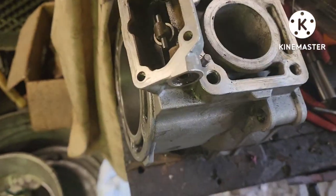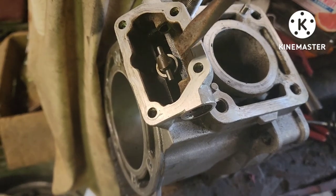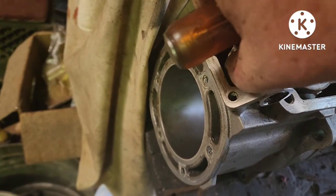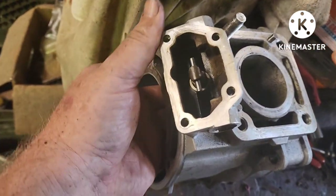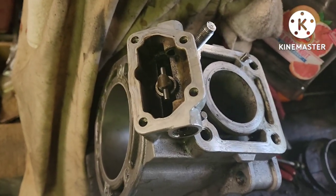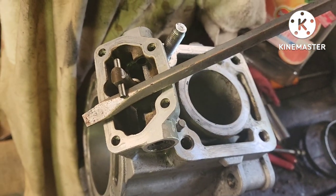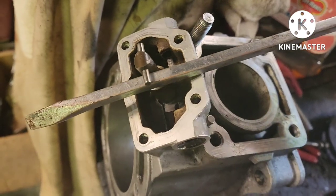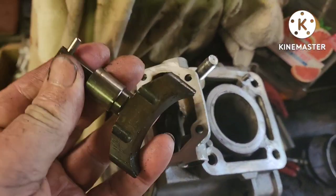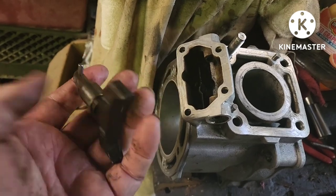If you've got a power valve in your 800, 1200, or this 1300, and it doesn't want to come out — what happens is they get carbon build-up on them. You can reach in and push them up by hand. You can spray penetrating oil — WD-40, PB Blaster — in there. This one was stuck, so I basically had to use something for leverage and pry it. You can grab it with pliers. I suggest putting a cloth under it — you don't want to damage these; they're unique to the 1300 and about $130 a piece.